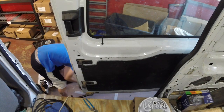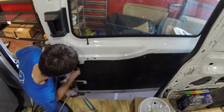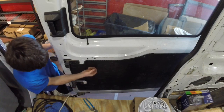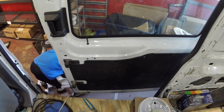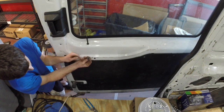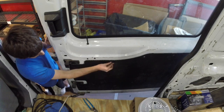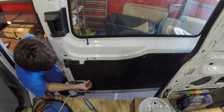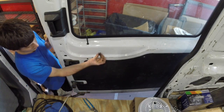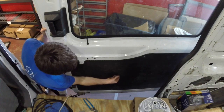All you have to do is install all of these clips back into the door. To get these off, there's a little notch, a little flat spot — take a flathead screwdriver and just pop them up, then put a flathead behind the end and pop this clip out. When you install them, just put the clip in first all over the door.